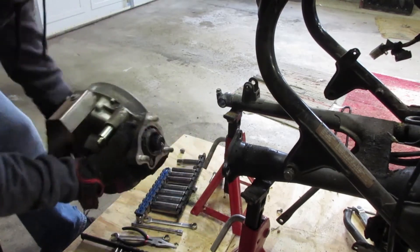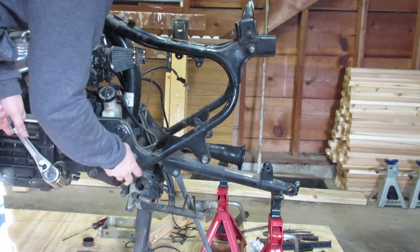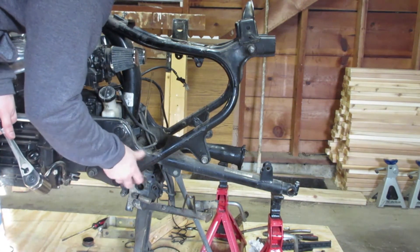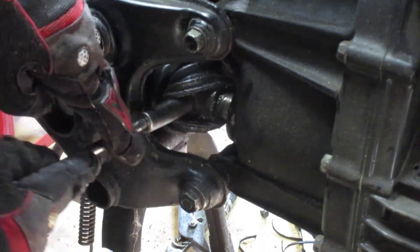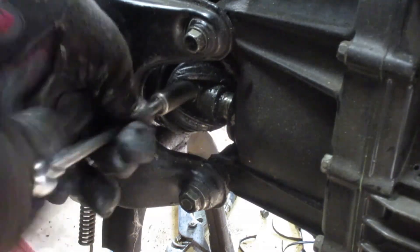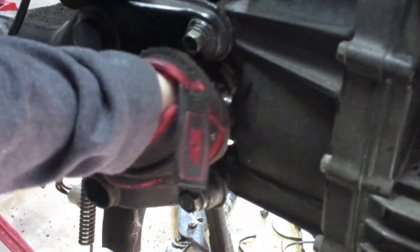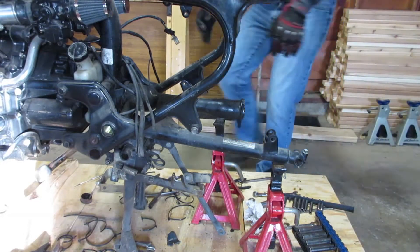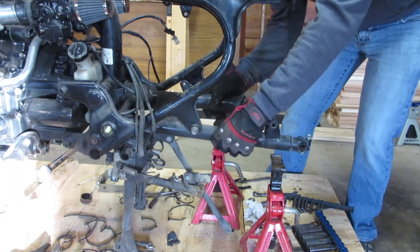The diff seems to look pretty good. Removing the rear swing arm basically involves removing a single main bolt. I ended up having a little bit of trouble removing the trailing arm, and then I remembered — there's a bolt on the drive shaft that holds the drive shaft to the output shaft on the engine. It's a little 10mm or 12mm bolt buried deep in the grease of the drive shaft boot. At that point it came out pretty easily.